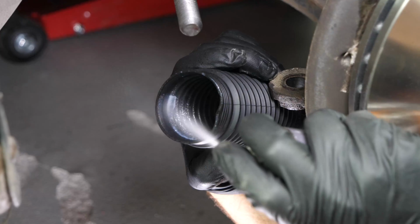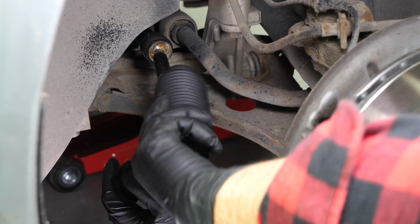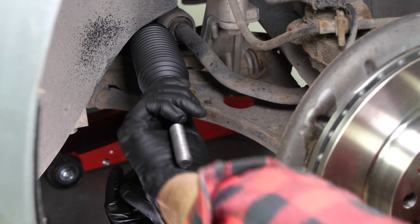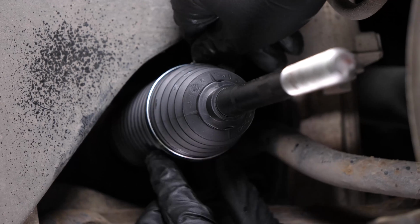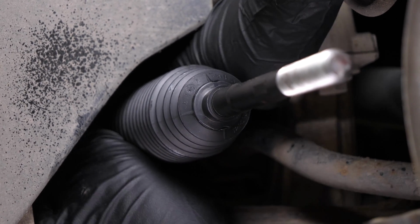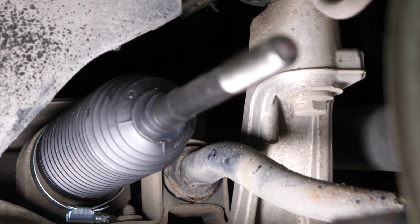Grease the end as it will make it easier to put the sleeve on. We recommend putting screw clips on, as access is really rather difficult when trying to use a specific tool. To make it easier to put the sleeve in place, you can turn the wheels so that the tie rod axle joint accompanies the sleeve and slots into its housing.